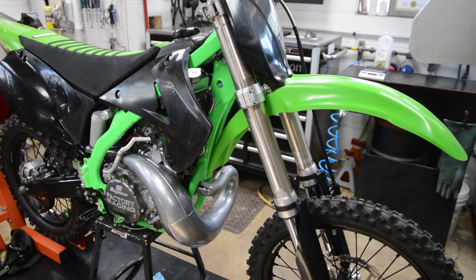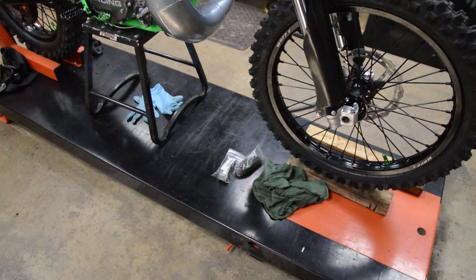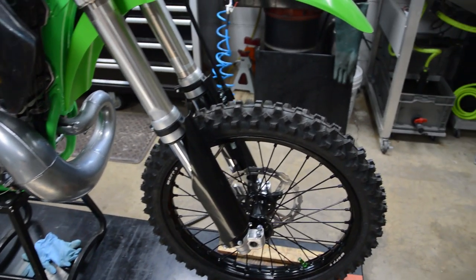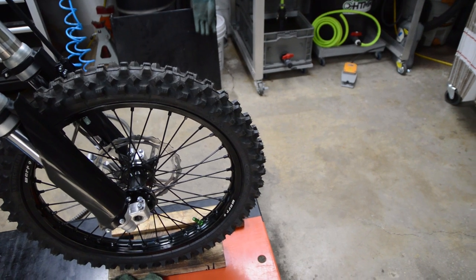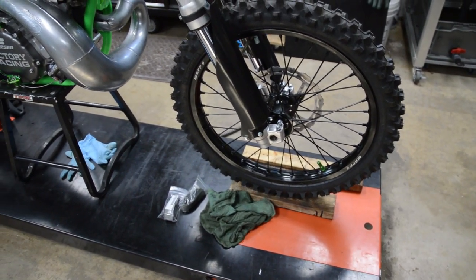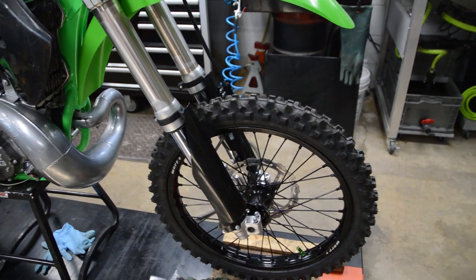And one thing I've got to do is the tires. Underneath the tires, under the rims, they're missing the rim strips. I had an issue with the bead, and I was poking around in there with the tire lever, and you noticed there were no rim strips installed. So these tubes will pop pretty fast. So I have to take everything apart and slap some rim strips on there.